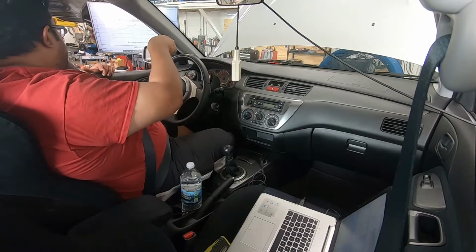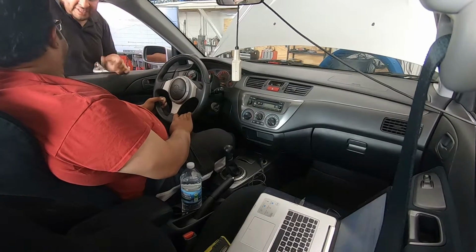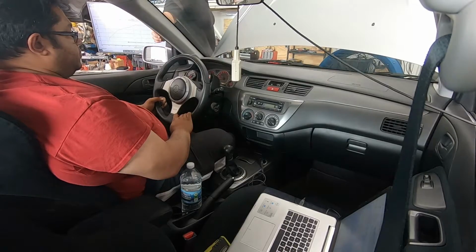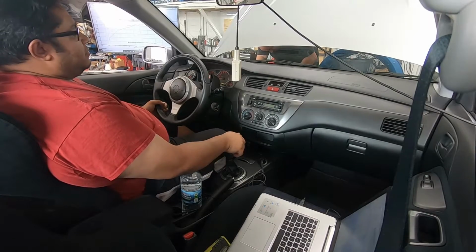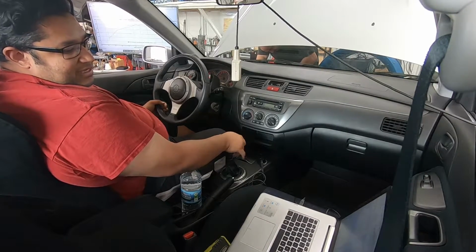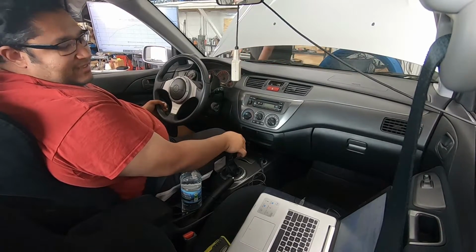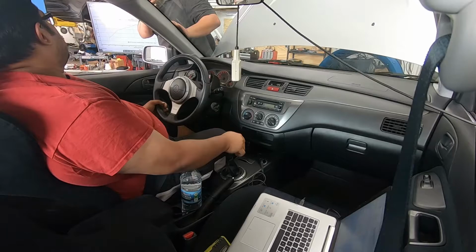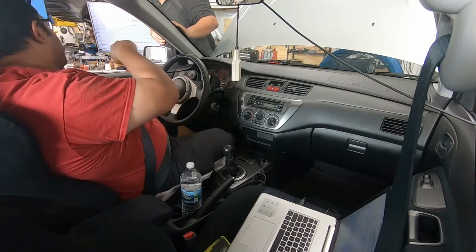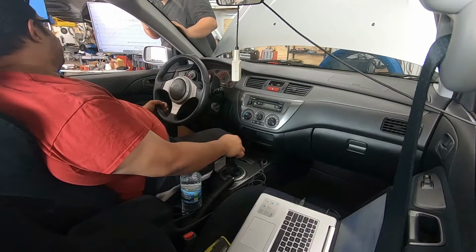Turn the boost controller 2 times. Clockwise or anti-clockwise? Clockwise. Increase the boost. That's the issue with manual boost control. It's manual. We have to manually change it. I'm just having a little fun. I'm trying to convey my dislike for manual boost controls, even though it's easier to, I guess, tune. You just don't have that much control over what's happening with the boost.